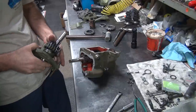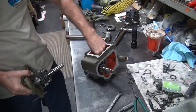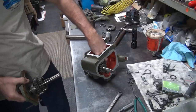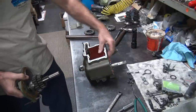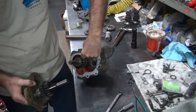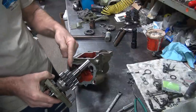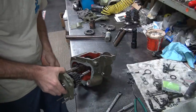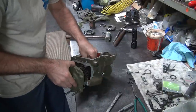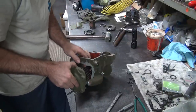Okay, this has to be engaged on the other side of the second gear retaining bracket. So if you put it inside the high gear like that, dog it in to hold it, then slip this assembly in and get the spline lined up. You should be able to slide it all together without losing everything. Kind of like what I'm doing right there.